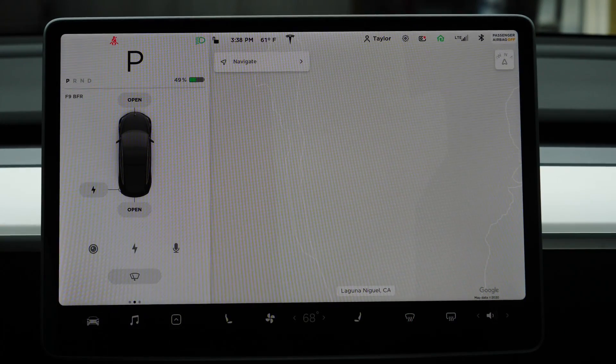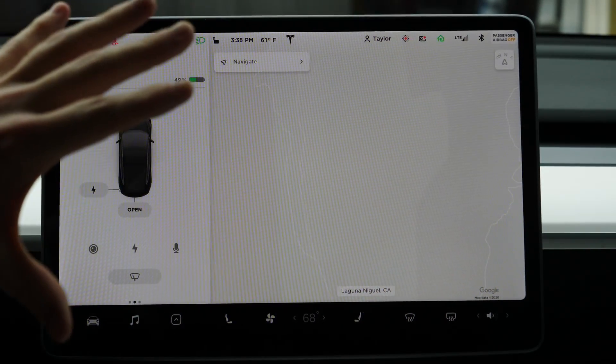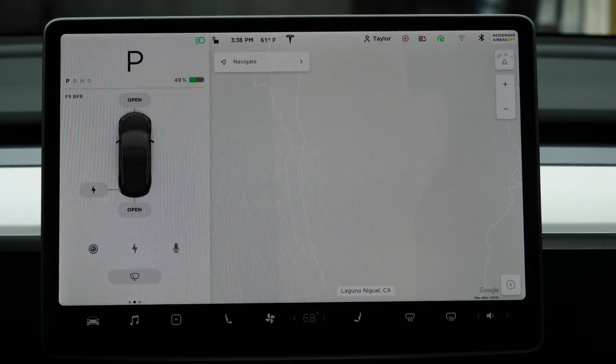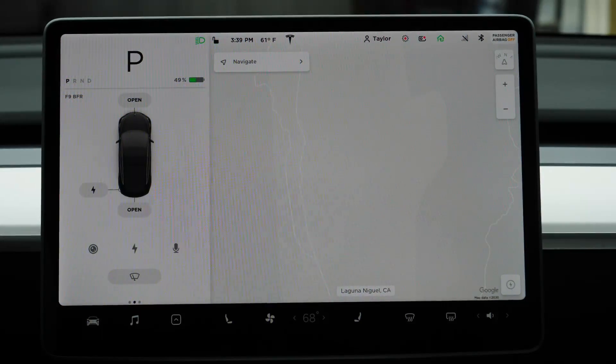As of right now, you are good to go dash cam wise. When you park, just tap that and sentry mode is on — you are now recording and writing data. Keep in mind that the dash cam saves the last 10 minutes of footage, which is really important. It constantly rewrites data that you haven't marked as saved. All sentry mode footage is saved when you get an alert and it stays on the drive, so if that fills up you're going to have to go in, delete them, and possibly reformat.